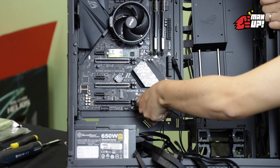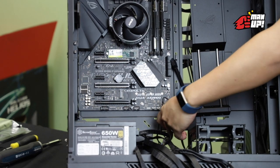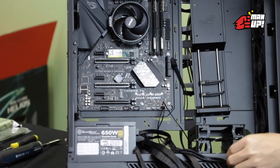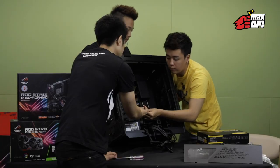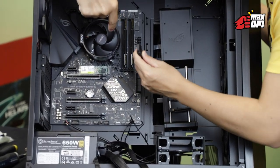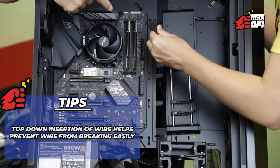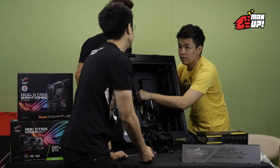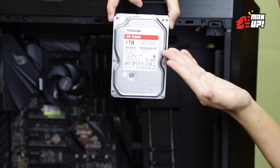The next one to plug in is the audio cable — the colourful one — at the bottom left of the motherboard. Make sure you are going in at a perfectly straight angle, top down. If not, the pins break and that's game over. Then there's the hard disk — 1TB. Usually these ports face the back because that's where your cables go, so this one is faced behind. Then just slide it back in — no screws needed.